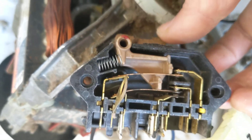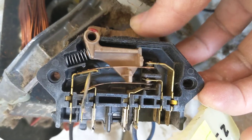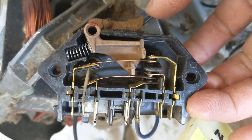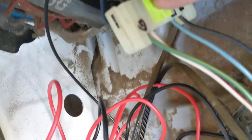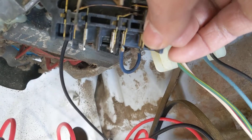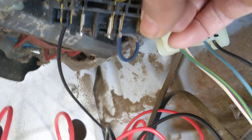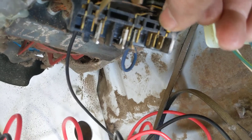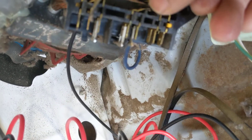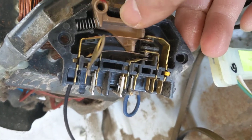The centrifugal force moves that wheel in the motor, which makes the switch go like this. And now the neutral terminal — this tab here, which was hooked up to the black wire — now has the continuous neutral connection, which makes the motor continually run.